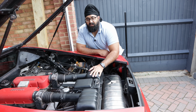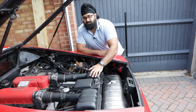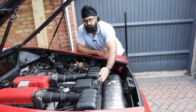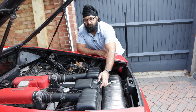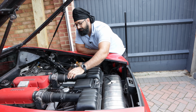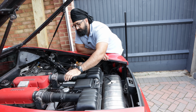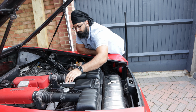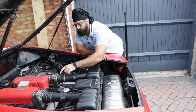So we're at the back of the car now. As you saw on those diagrams, that's where the expansion tank is. So normally this is where you'll check your coolant level and fill it up again. Off the top here is where we have the overflow, and at the back here, which you can't quite see from that angle, we have these two return feeds, but we also have this thick rubber pipe going from the expansion tank to the water pump.